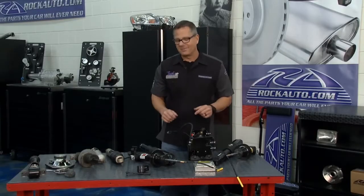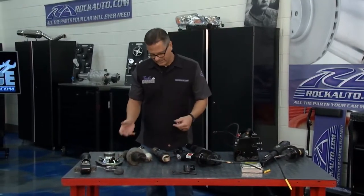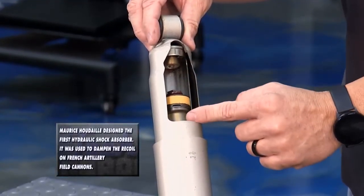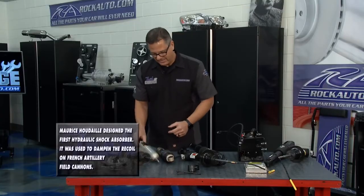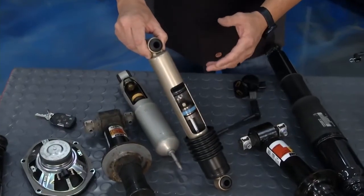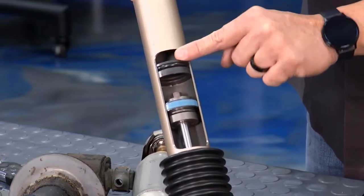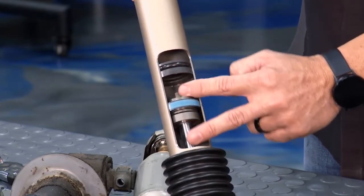Let me show you the beauty and magic of this system. Let's go back to the basics of shock absorbers. We started out with the monotube shock absorber — just a single tube — and the fluid would go past this little valving, and the valving determined how it bounced. These things control spring oscillations. Here's a gas shock. What makes it a gas shock? There's a gas chamber right here that holds pressure on the liquid so you don't get any aeration in the system when it's going really fast.